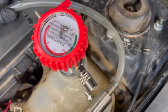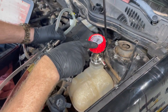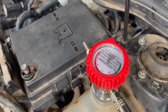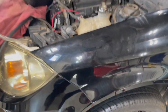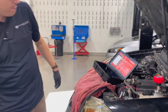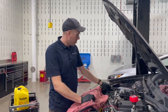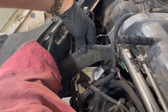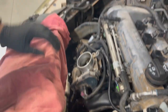So we've got a good amount of vacuum on there. I usually like to disconnect that and get it out of the way. A good leak check procedure is you can pull a vacuum on here and watch for decay. If you have a leak — maybe a hose clamp that's not fastened all the way or something like that — watch that decay, let it sit 5 to 10 minutes, and make sure there are no leaks. You can see here it has sucked down — these radiator hoses are totally collapsed, so the whole cooling system is under a vacuum.